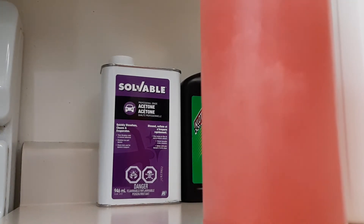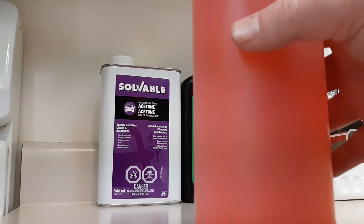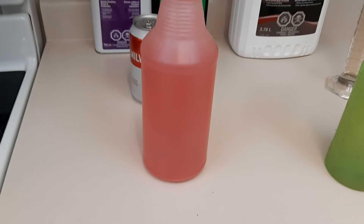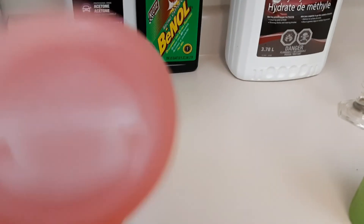I was going to do this with medical grade castor oil but I couldn't find any in my area, which kind of sucks. That's why I'm using the good old standby from Klotz. I still plan to do a version with everything from the hardware store or grocery store, but I want to see if this actually works first before spending $25 on medical grade castor oil. So lids on tight, give it a shake — looks pretty good. The oil content works out to roughly 10 to 11%, which is fine; that's more than enough.